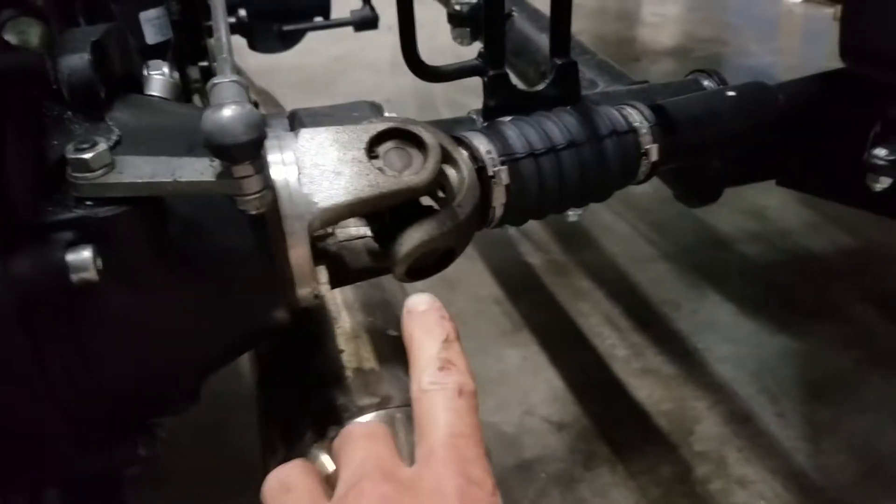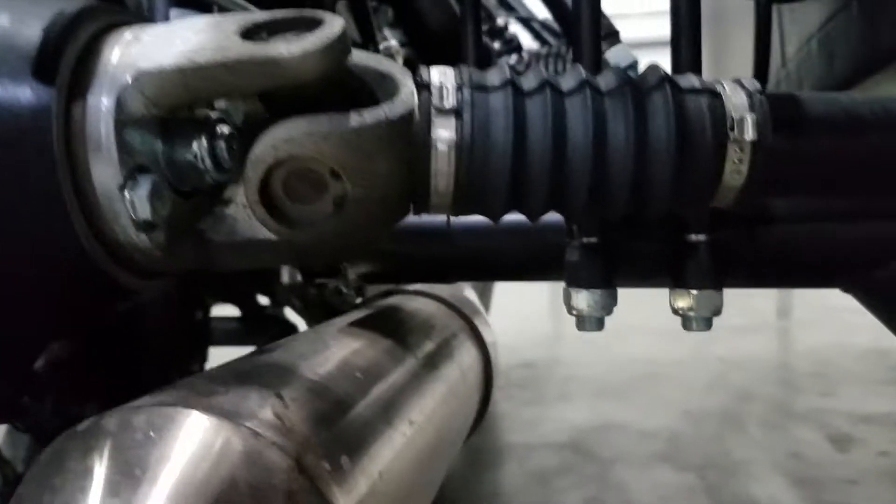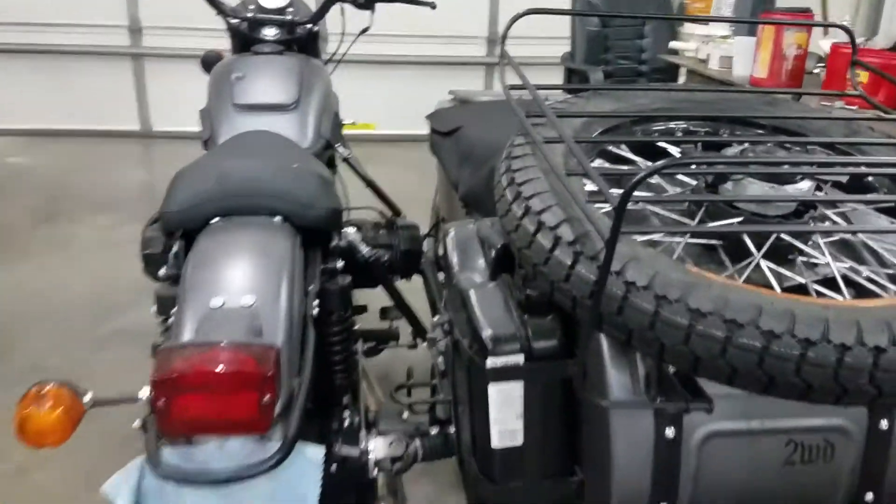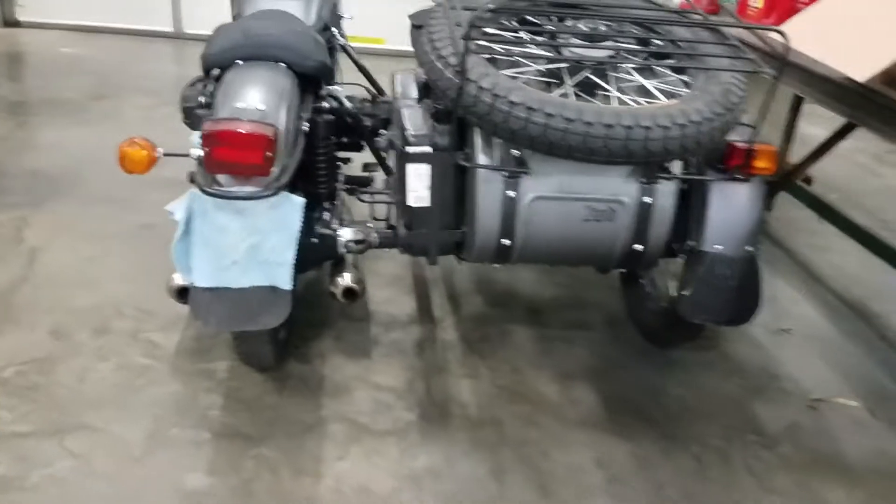That's the other thing that's always upsetting — this is in the setup procedure. See how the shaft is turned that way? We're looking at the end of the U-joint there. We should go straight across and be looking at the end of the U-joint, but we're not — the shaft is about 90 degrees out. So that'll need to be adjusted too. When we have the final drive out of it, we'll go ahead and adjust that as well.